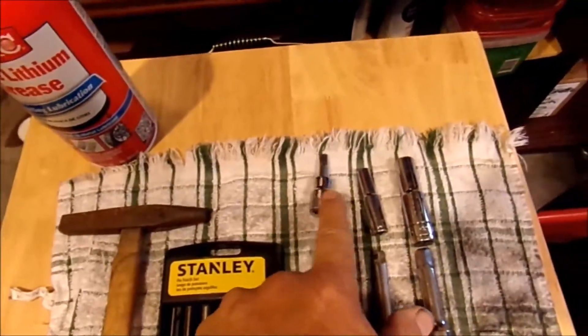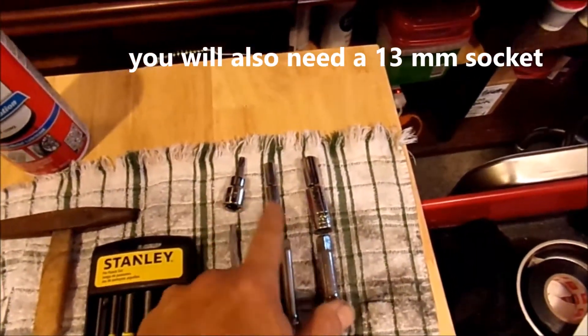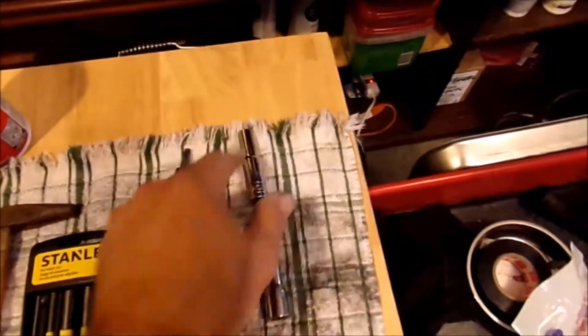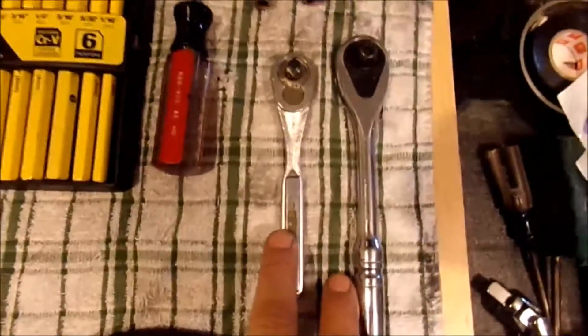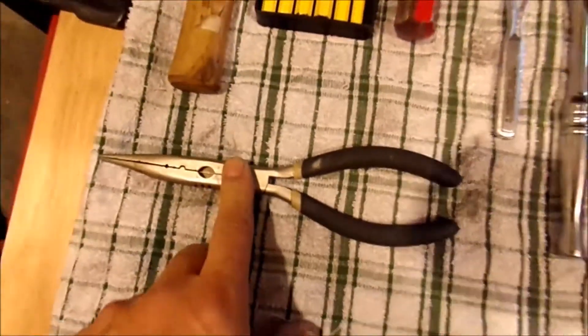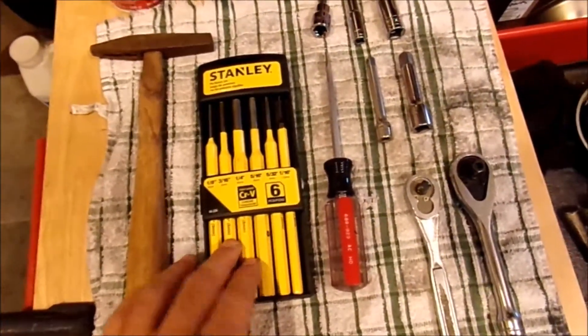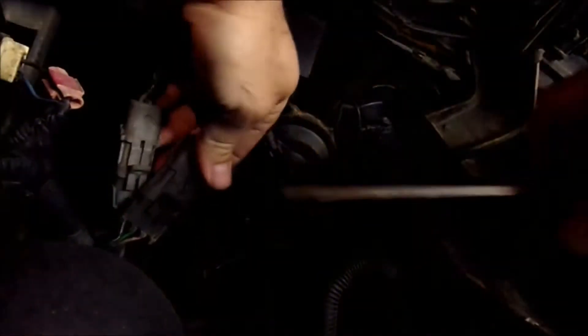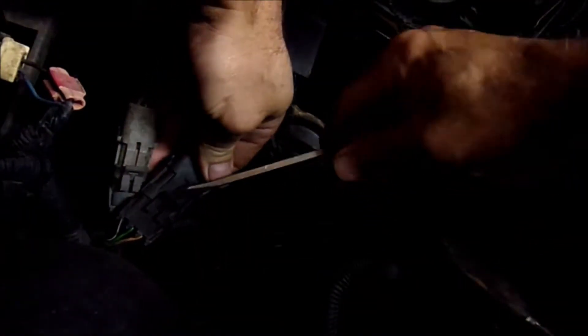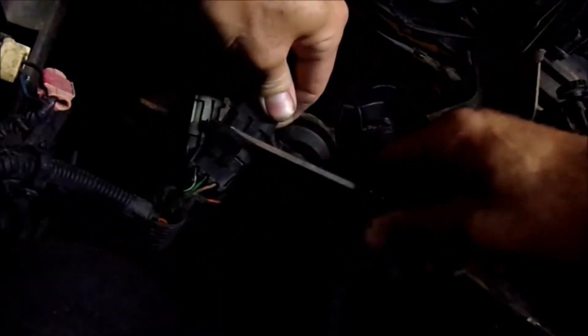You've got your T30 Torx which should fit all your Torx fittings, your quarter inch — some of them are deep well, some aren't, but I just use a deep well — and your 10mm, ratchets, extensions, and a screwdriver. I'll need a light weight hammer too. That roll pin shouldn't be in there very tight. On your plugs here, just kind of pop that up, get it started, and they will come right unplugged.